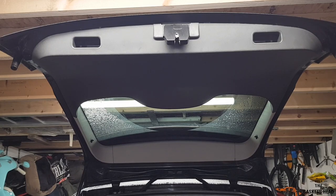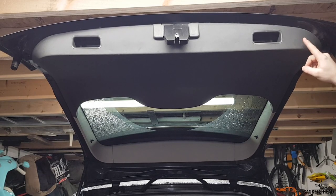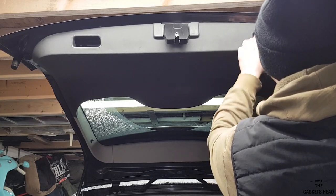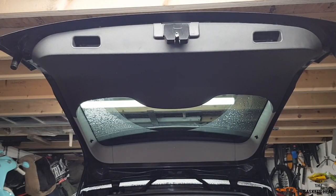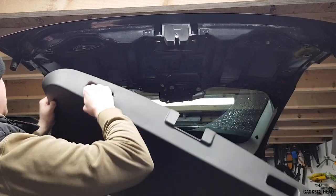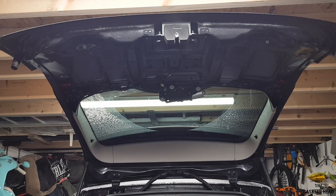Obviously it's quite tricky if the boot won't open — you'll have to find a way of getting into the boot or into the wiring loom to get it open, because getting the panel off with the boot closed will be tricky. To get this off it's really simple — just two T25 Torx bits in the handles. We'll whiz them out, pull this down, and they're only on little spring clips. That is as easy as that — panel's off.